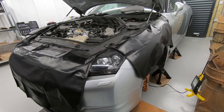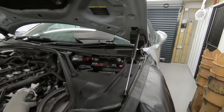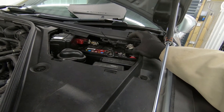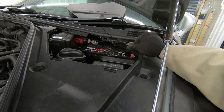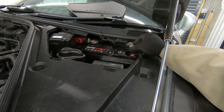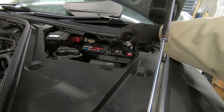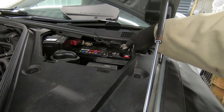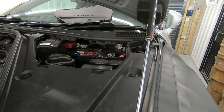The first things I've done: I've taken the road wheels off, I've jacked it up, and I've also removed the negative terminal on the battery. You need to make sure that you do this. The starter motor has pretty much a direct connection to the battery via a very large fuse, so if you do short it out when you're doing the starter motor, you're going to be in trouble. A good idea is to just take the negative off and use a wire tie to tie it out of the way, so it can't accidentally touch back on the battery.